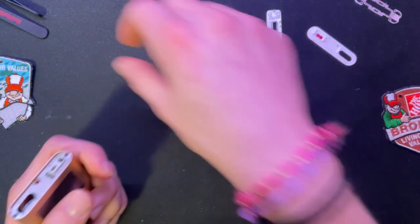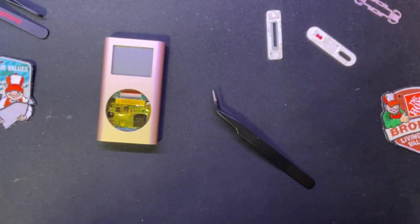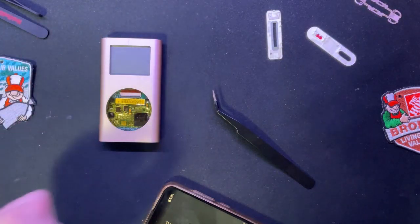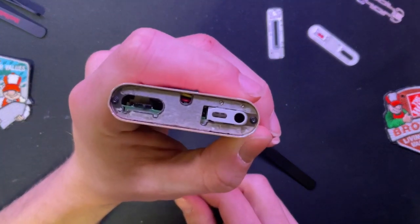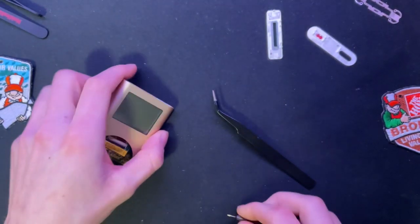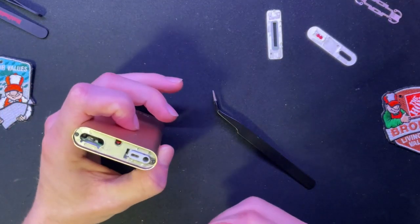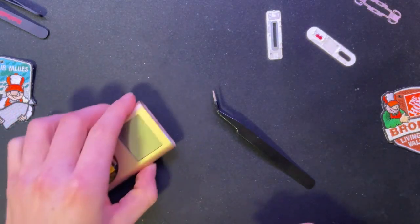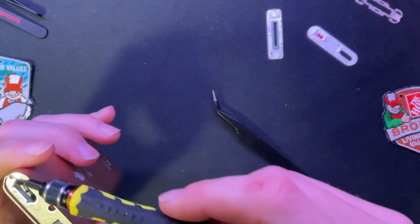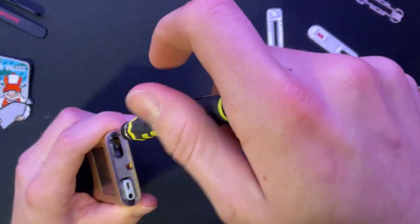But after that, you get out these screws, which I'll grab the screwdriver real quick. While this thing was dormant, I lost the screws. These are Torx screws. Not sure if they'll show up at all. They're T4s, and they work fine. They actually work a lot better than the screws that came in here because those ones are really stripped. I'd say if you want to replace the screws on here, go for Torx screws. Just make sure that you're careful and you don't strip them.